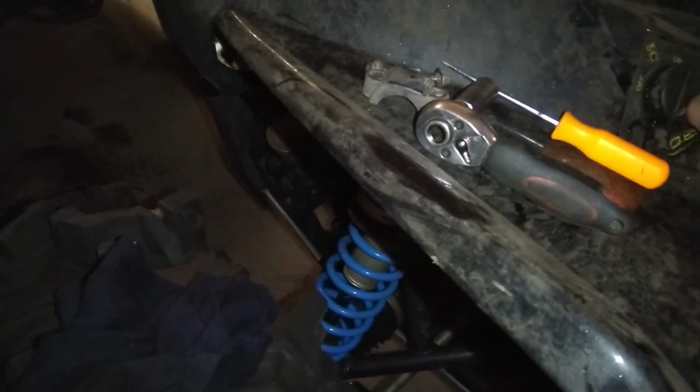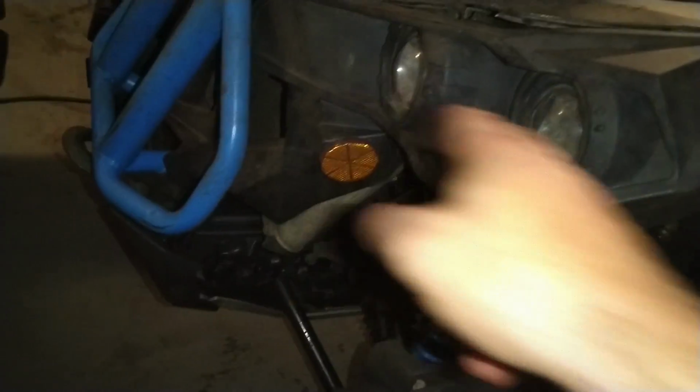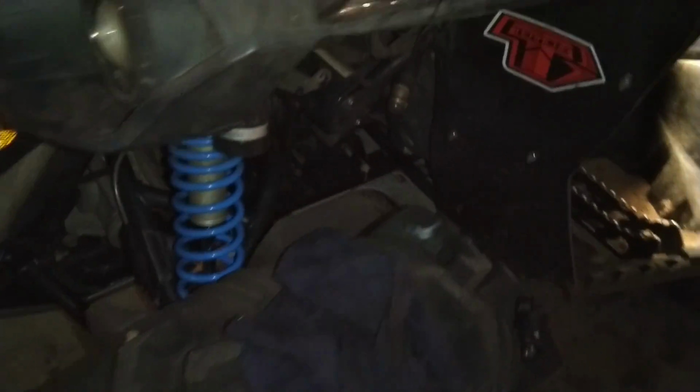Once I cleaned everything, now I got this weird thing where when I'm in the light position, it runs the fuel pump, it ticks, a bunch of stuff's going on. But when you're in off and on, none of that's going on. Which tells me when I have the headlights on, by the way, they're not coming on, some of that power is somehow back feeding into the system and giving things juice.